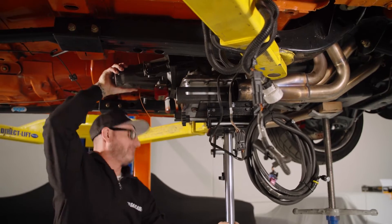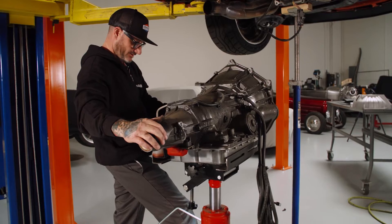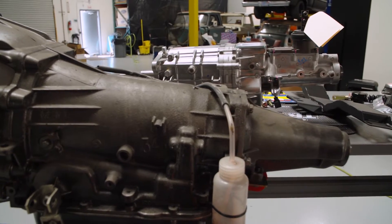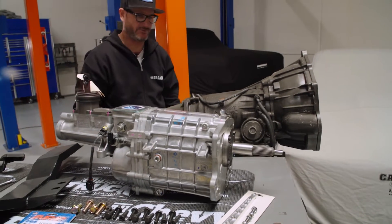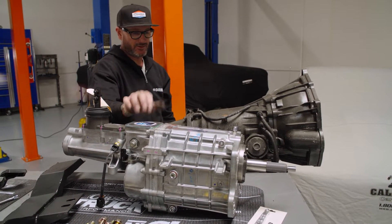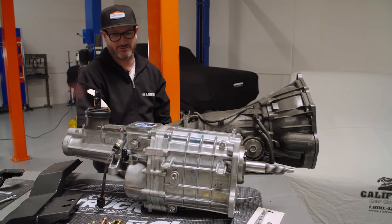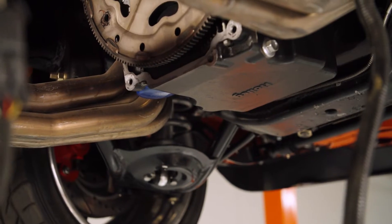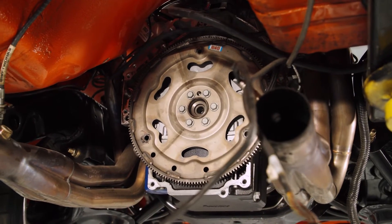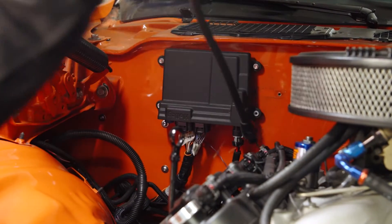In front of this automatic trans is an LS3 376, 520 horsepower, and 530 torque. The TKX transmission is good for 600 on the torque side, so plenty of strength to handle our LS3. One trans out — look at that difference. Of course the bell housing's not on this one, but the bodies are pretty close in size. That's why it's going to be awesome to put in. No cutting or fabricating to the tunnel is going to make it so much nicer. Let me get the transmission dipstick off the firewall — I won't be needing that.